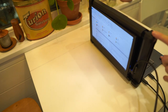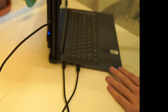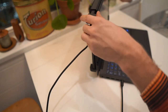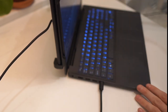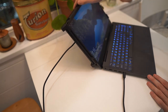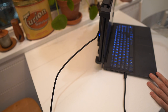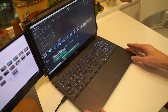Moving the hinge back and forth adds quite a lot of weight to the hinge. With a 14-inch laptop you get good support from the base of the Ophia Tri-Screen, but if you switch to a 15-inch, you don't get that base support, so the hinge has to hold up all the weight of these screens — about 1.3 kilograms. You can see that if you fold the screen down, after some time it will start collapsing and moving down. Keep this in mind if you want to use it with a screen larger than 13 or 14 inches.